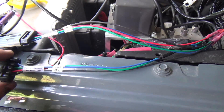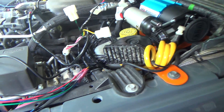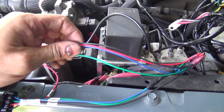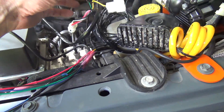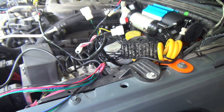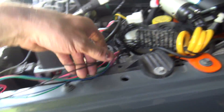Switch one on this first module will be the main ARB compressor power — I flip that on, the compressor will spool up to around 100 PSI, and then I can air up tires or whatever. Switch one and two on the second module are the actual lockers. Switch one feeds into switch two as the inbound power, and then the two outbounds are locker one and locker two. I'm getting ready to put all that together. Common grounds on all these switches are just going to the ground on the ARB.